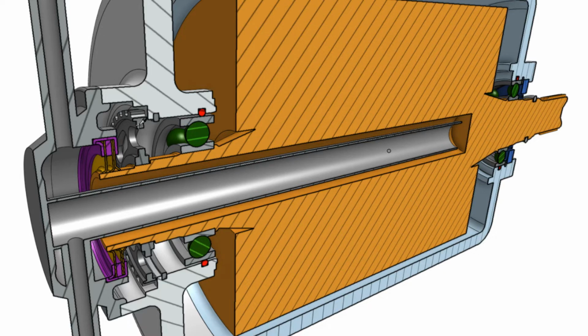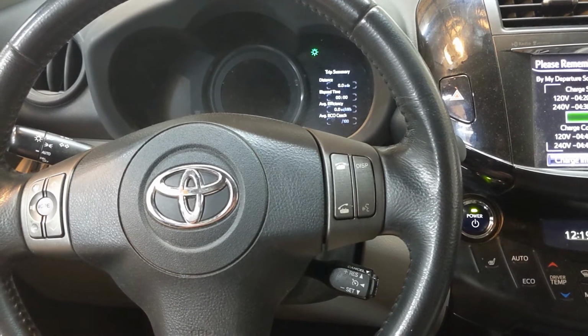When there is a leak, the fluid can pass the broken seal, go into the volume over here near the reluctor wheel, which is shown here. Then the coolant can flow through the bearings into the cavity between the rotor and the rotor housing. Then it can flow towards the inverter. So first it has to pass the transmission, and then it can damage the inverter electronics and your car will stop.